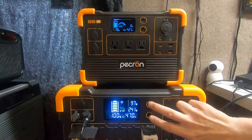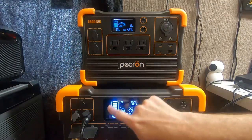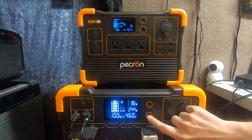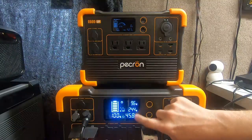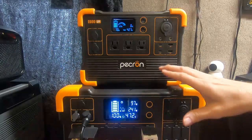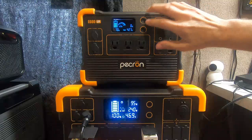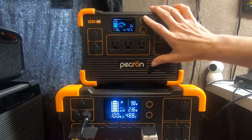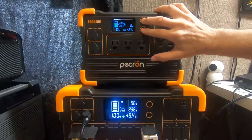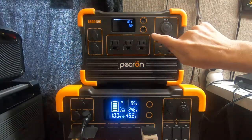So back to the most important thing. You guys remember this other video — how you had to hold down both buttons, that wire frame would flash, and then you'd hit the AC button on the bottom twice and you would get a firmware menu you didn't even know was there? That was the hidden menu that built this entire YouTube channel. You're going to do the same technique here. Hold down both buttons, you'll see that wire frame on the battery flashing, then hit it twice. Look at that — that's a hidden menu, guys.